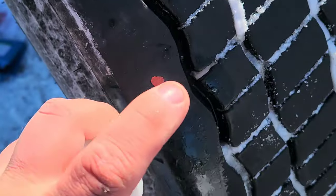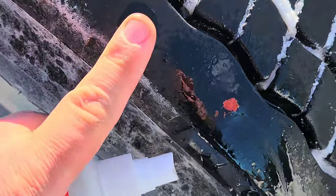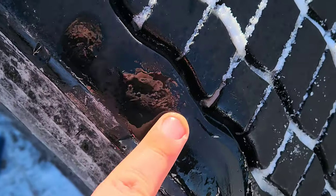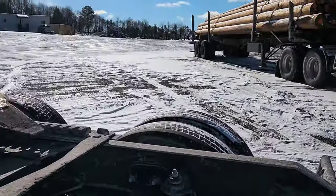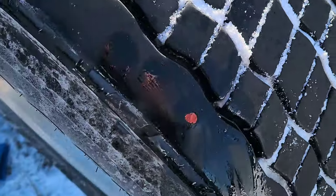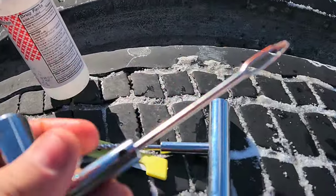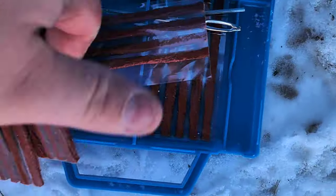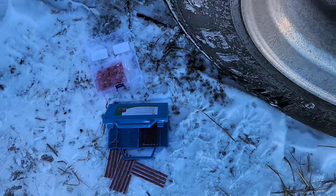Plugging a tire at 13 degrees with about a negative 10 or 15 degree wind chill is not the easiest thing, especially on a big truck tire. I'm going to keep an eye on it — I don't know if I got it inserted enough. It went in about two, maybe two and a half to three inches, but usually on a warm 80 or 90 degree day I can insert these almost all the way before cutting. This one went in maybe halfway compared to usual. I'm also going to show this plug kit — pretty heavy duty stuff. There's the reaming tool and also adjustable tools with an Allen key to swap tips. I'll put a link in the description.